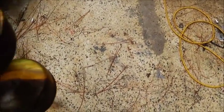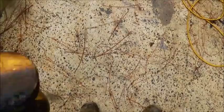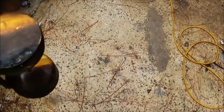But I was cleaning it up a little bit, and I looked to the outside, and I don't know if you're gonna be able to see this or not, but at the bottom there's another hole on the outside of it. Let me get you in frame here. It looks like a hole and maybe another pit beside it, so I'm going to clean it up and solder that too. It really needs a new float, but we just want to try to get it started, so we'll patch this up long enough to do that anyway.